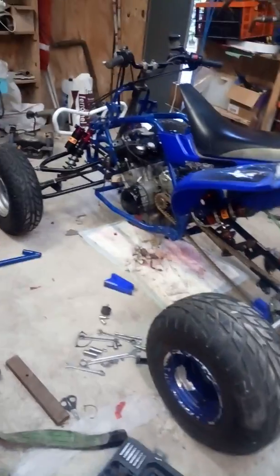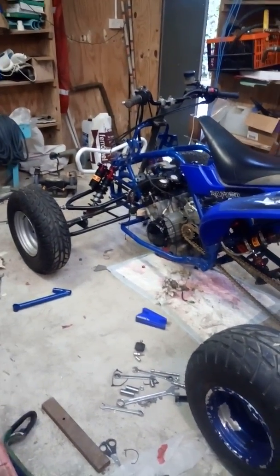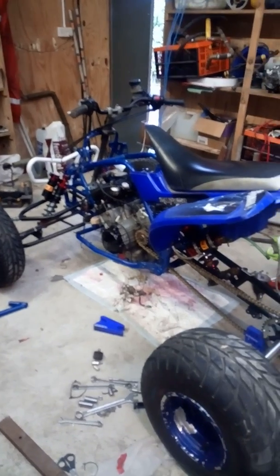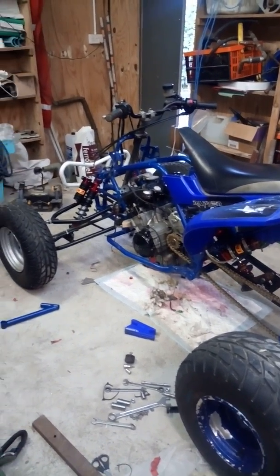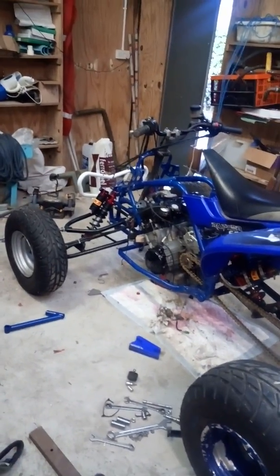There's the back brake as well with a little shade floating about — not good. Generally he's got all the bits, they're just not put together well. So I'll give the guy some credit. We'll see after I'm finished whether I've got an idea or not. Get the engine out, get the frame straightened up, and I'm going to do a couple more videos on how to realign and re-weld the frame and get the engine remounted.